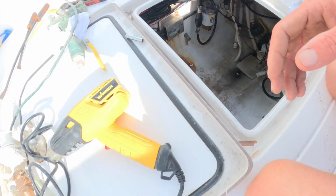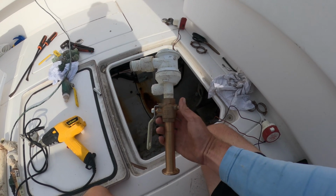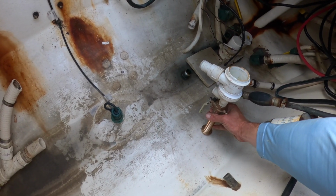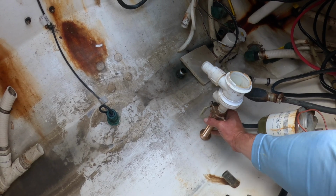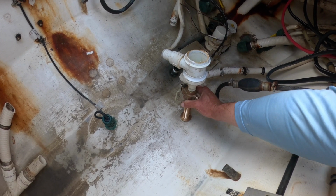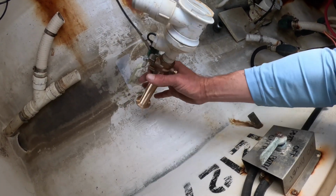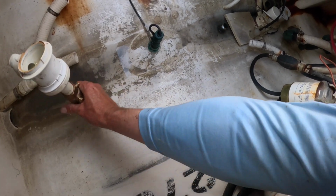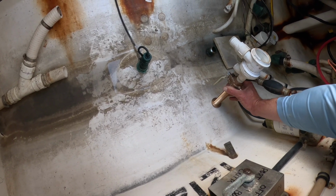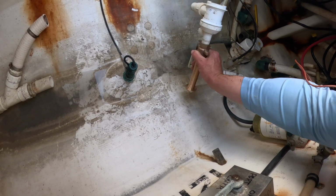Our big thing here, that's the full pump setup right there. Our main thing is to be able to get these things to catch enough water, and to be low enough into the boat, basically far enough away from each other to where these two pumps aren't colliding on either side. A big thing with this is make sure it's behind your transducer. If this fitting is in front of the transducer, it's going to throw water and disturb your transducer and not allow you to read bottom while you're running, which is a big no-no. So we've got to keep it behind the transducer and just far enough away from each other to where these pumps on either side aren't touching.